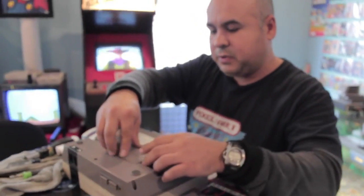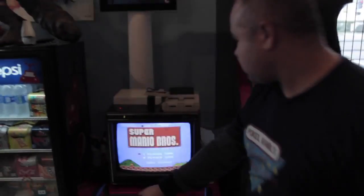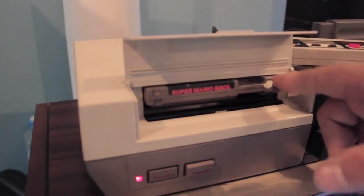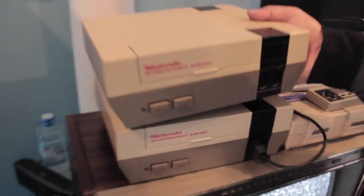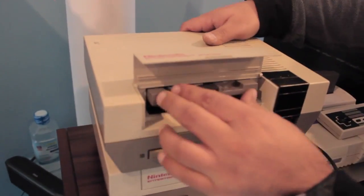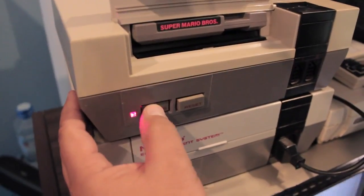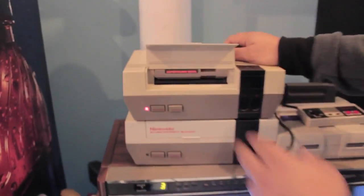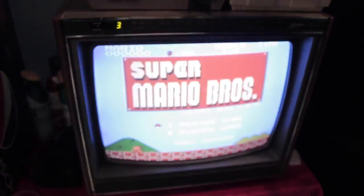Now let's bring it over to the tester. Here we have an NES playing — this is how it should work. As you can see, it's got the Nintendo NES game raised up. You don't have to push it down. So let's turn this one off and test our repaired unit. Put the game in, don't push it down — just insert it and hit the power button. Bam — there you go, first try. Remember guys, raising those pins and cleaning them thoroughly with just alcohol — do not use Brasso on the pins. Let's do it again — stick the game in, first try, every time.